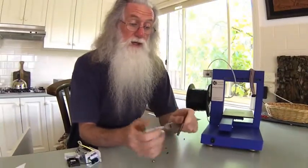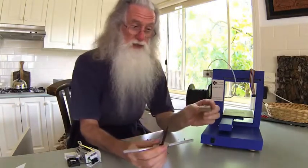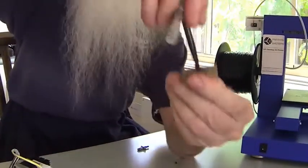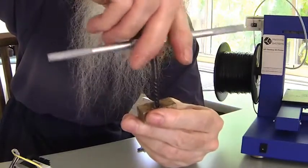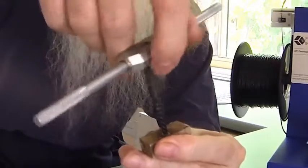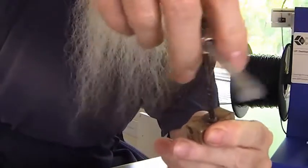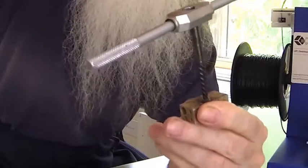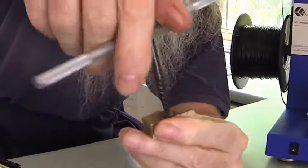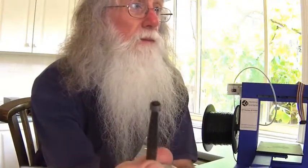These just fit in and you nip it up. When this has been soaking, dry it out, come back, push it in, then turn it in the direction to undo the thread. As you can see, this one is now coming out. If it does start to get loose, push it down a bit harder and then turn it — but not too hard, as I said, or you'll just strip the brass. Then undo it, and out comes the broken part of the thread.